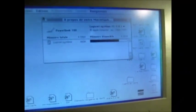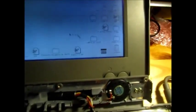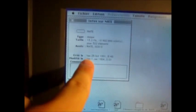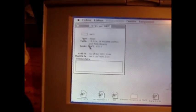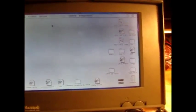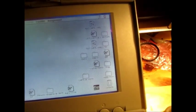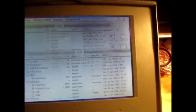As you can see, it is definitely working — running System 7.0.1. The hard drive is here. I'll do Get Info and you can see it says 13.2 megs, initialized Thursday 25 October 1991 at 8:48 AM. I didn't cheat — I just moved the head and the hard drive boots. And it's not the first time I've done it on this one. So far I've not had any problem with the hard disk itself — no bad sectors or anything like that. It's just absolutely fine, except it won't start on its own, which is unfortunate.